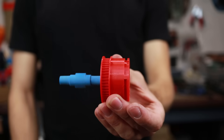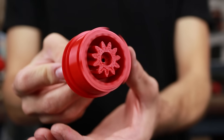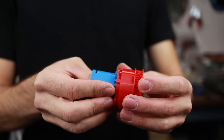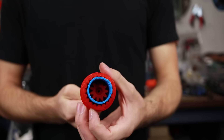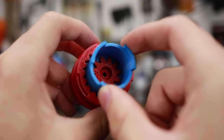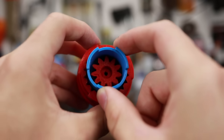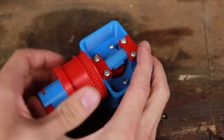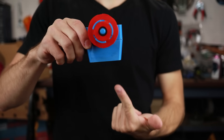The drum sits on a bearing that separates it from the camshaft, and currently they are completely independent from one another — until I introduce this other spline which serves as a medium between the drum and the inner spline, and now the whole system rotates as one. The real magic begins when I push and pull on the blue spline: it rotates the camshaft a few degrees without interrupting the outer drum. This means I can now change the intake timing without ever needing to stop the engine. It's almost been 6 minutes and I still don't have the bottom end, but I think I've got something.